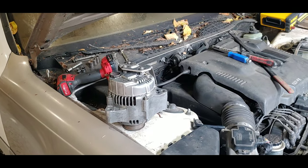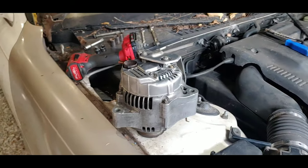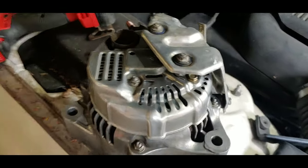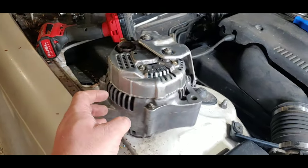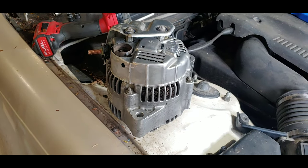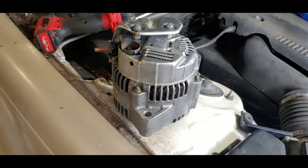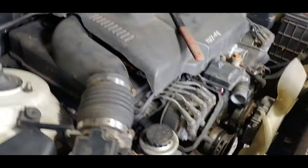It's another day and the alternator's back. I couldn't really film at the guy's shop — it was really, really busy, so I didn't want to bug him about my YouTube channel. But it's rebuilt — look how nice it looks now. He cleaned everything up and all the guts inside are brand new. He kind of laughed when he told me what was wrong with it. I dropped it off on a Thursday at around three o'clock, and Friday morning at 8 a.m. he called and told me it was ready. Basically everything inside was shorted out because of the power steering fluid.